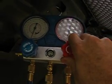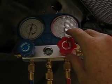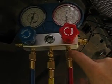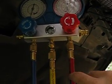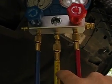You're going to charge only through your low side. One of the most important things here is you want to make sure that your high-pressure valve is completely off. When I start charging, I will see pressure on the gauge, but no Freon will be flowing through that line. The Freon will flow up here and down into the low side. I'm going to put in three cans.